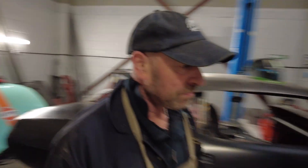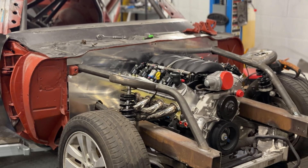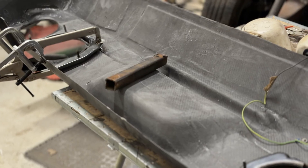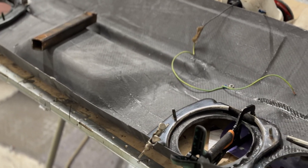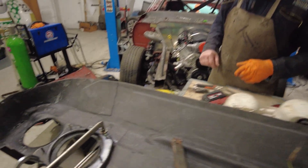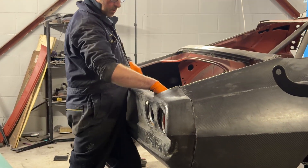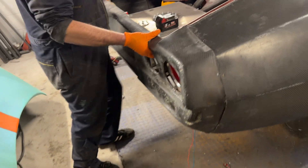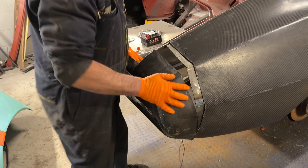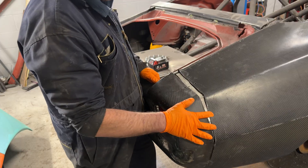We've got a garage dog! And he's gone. He doesn't care about Camaros. So you just sort of cut the bulkhead. Yeah, we've got to put some pieces around here and make it all look nice. This is the rear panel. So what we do before I actually fit this is just bond in where the headlights are going, where the rear lights are going to go — so they'll pop onto there. Bomb them in, don't have to worry about that. Bonded on. But I've just got a few little bits and pieces to do first.